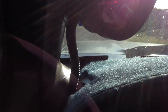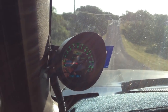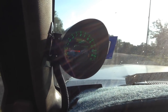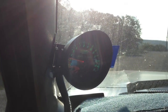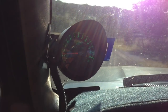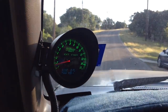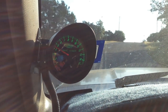Let's go ahead and take this thing for a test drive to show you guys that it all works. All things considered, I'm pretty darn happy with this gauge. So far everything seems to be working just fine — exhaust gas temperatures, reasonable transmission temperatures, and boost pressure is just kind of cool. I haven't had any hiccups just yet. One thing I would caution you on: if your gauge is just flashing, that's probably because a connection isn't all the way made in one of the probes. Make sure all of your probes are hooked up and connected to the back of the gauge to get it to stop flashing. In the event that you aren't able to fix the problem, there is of course the potential that the gauge is defective, given that this is generally a lower-cost brand. But right now this thing seems to be good quality — the wiring seems a little thin at times, but other than that it's working great. Time will tell.